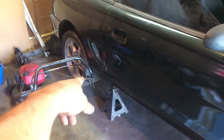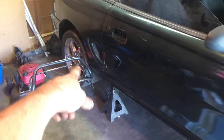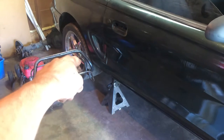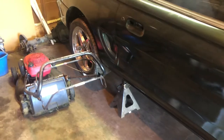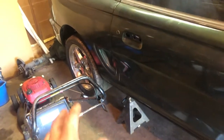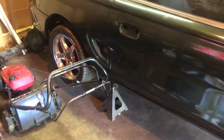Another thing we'll be doing — this was a V6 car and still has the V6 rear end in it. We're ripping that out and putting in an 8.8. We're going to build the rear end, put a full spool in it, and do complete aftermarket upper and lower control arms on the rear. I've already got my coilovers on.